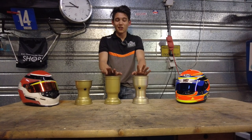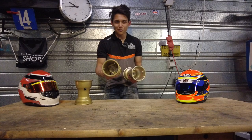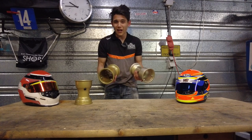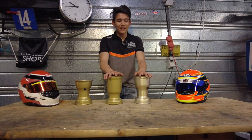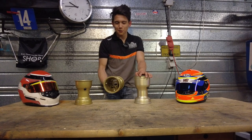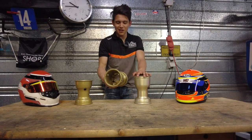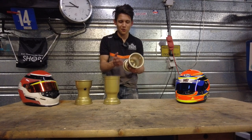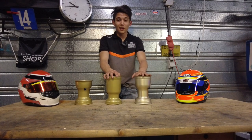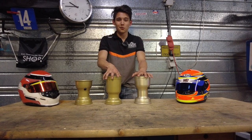If you're racing a senior Rotax kart on a Tony Kart chassis, MXC rims are almost always the way to go. Some drivers never touch the standard MXJ rims, though I wouldn't go that far — when it's cold and the track is slippery, the MXJ is really the superior rim. Lots of drivers on non-OTK chassis also use MXC rims just because of how consistent and trustworthy they are. Quick recap: MXC rim — super consistent, a little bit less grip, ideal for hotter conditions; in the cold, stick to the MXJ.